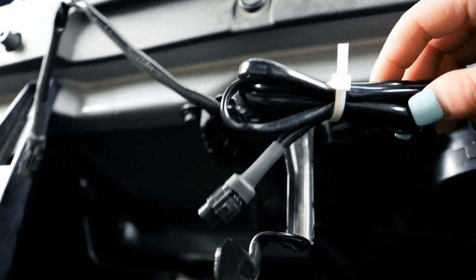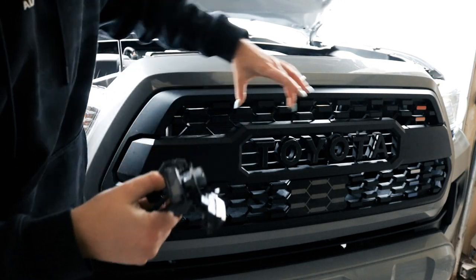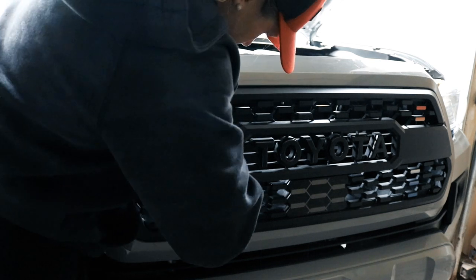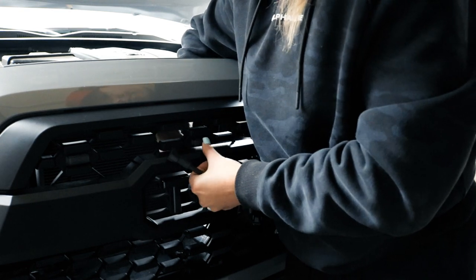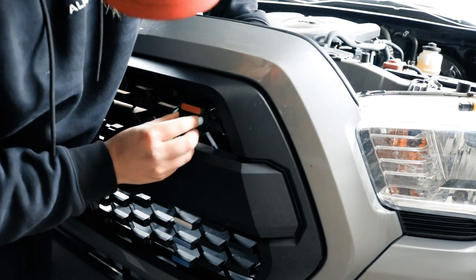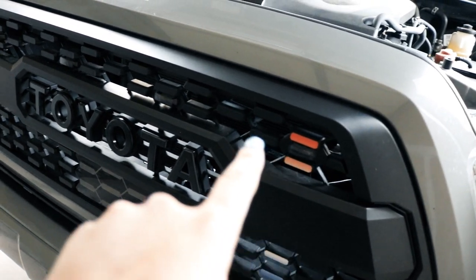The harness for the lights is still attached to my fuse box — I've got them zip-tied here. These are the adapters that go into the lights, so that's what I'll snap them back into when I rearrange them on the grille. I've got my four lights here, and instead of having them right in the middle, I'm going to spread them pretty much across the entire grille. They just snap right in, so it's going to be every other slot. Now they are spread out across the grille.